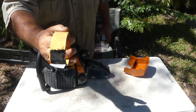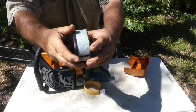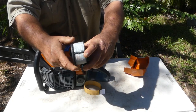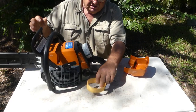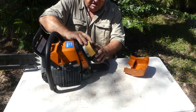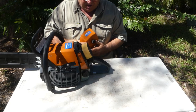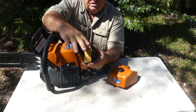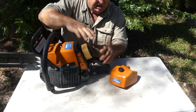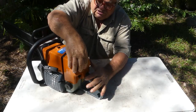I've blown both components of the air cleaner out. There is a little bit of difference. Really the saw hasn't done that many hours to actually require the air cleaner being cleaned, but I did say we were going to prepare both saws the same way. Assemble your filter again with the piece around the outside, place your filter back on, put your cover back in place, and lastly screw up your knob.